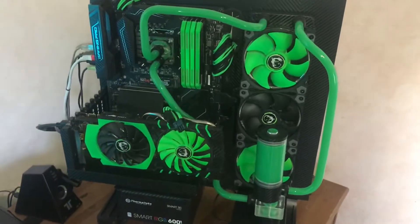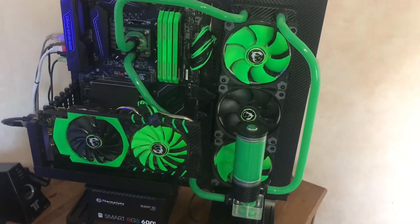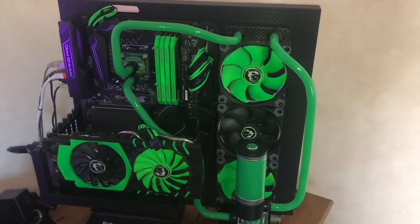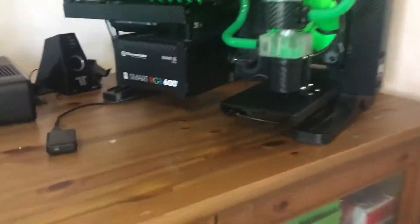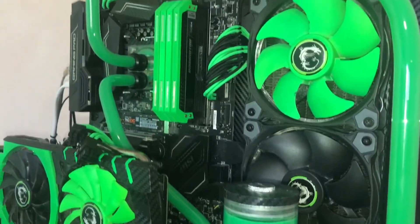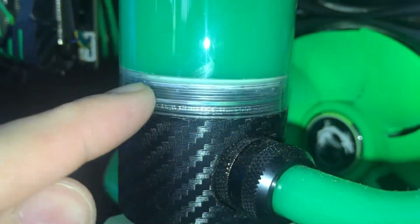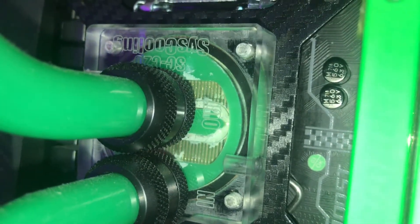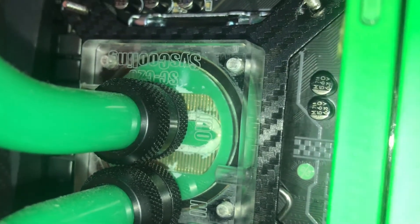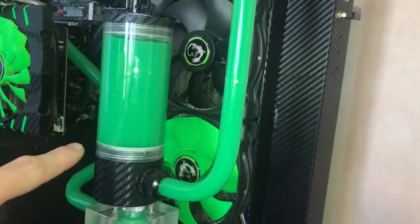It's been a while since I put in the coolant and I have a lot of issues with it now. I ordered it months ago when it wasn't even out yet, so stuff was unclear. They said it was the fancy fluid without the drama, but even two days after I installed it, it started breaking apart. You can see there's white stuff here — it's hard to see on camera — but the best place to show it is the CPU block. You can see it's absolutely clogged with white dust. The particles just let go of the fluid and clogged the rest of the system, and there's almost no visible movement anymore on the CPU block.